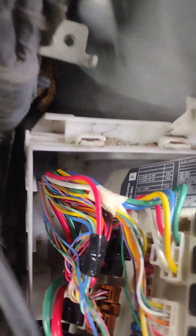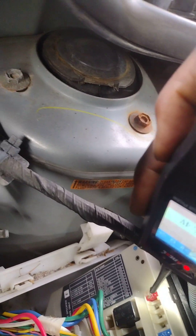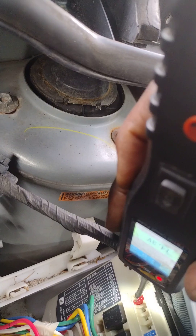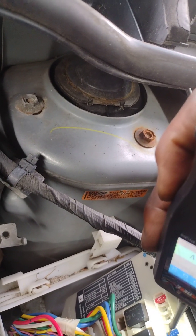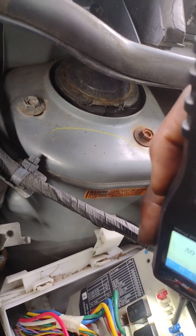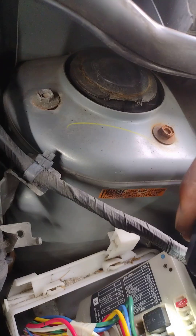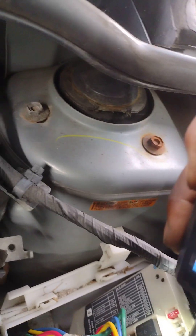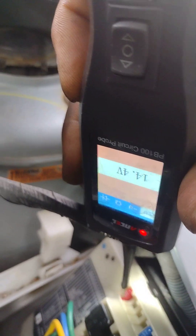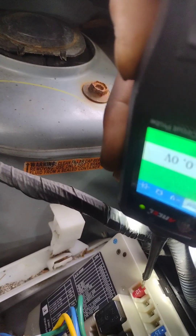It's working. So now I'm going to check the fuse. That is good, that is good - the other side shows green. I see a green and a red, which is not good. It's supposed to be red on both sides - that means the fuse is good. You go to one side, you should get power - you can see the power from your battery, 14 volts. But when I check the AC compressor fuse, one side shows 14 volts and the other shows green. That means there is no continuity - the fuse is broken.